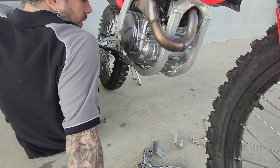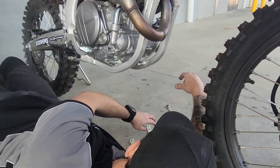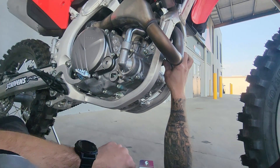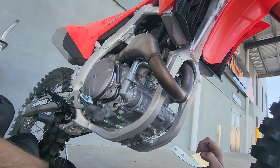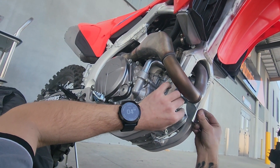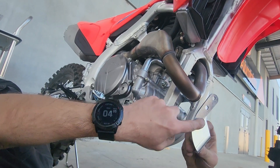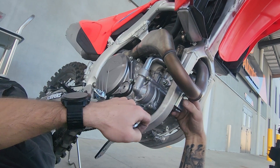Now for the installation of the brackets, I'm just going to lay down on the ground here. I've got the pre-installed engine mount bolts — you can see they're much longer than the genuines. Determine which side the bracket goes, as there's an extra return here — if you put it on the wrong side, it's going to clash with the frame.